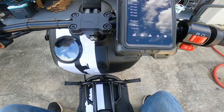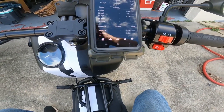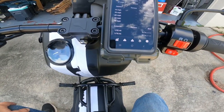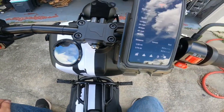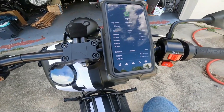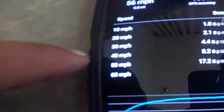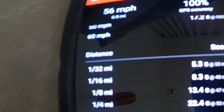No big speed improvements today, but boy does it run good. When I was doing the air filter mod I couldn't get the bike to run with the air filter, so I grabbed a bigger main jet from the drawer and threw it in to get it to run. I must have just happened to grab the right size jet because everything I went up on was too rich. Our last speed run was 56 miles an hour, the zero-to-30 was 4.4 seconds, and the eighth mile was 13.4.